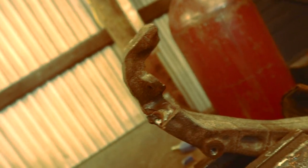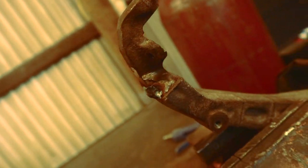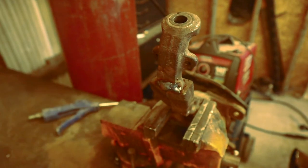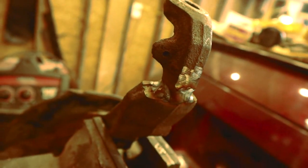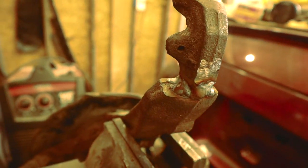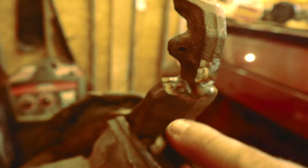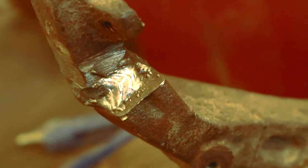What you want to do is go as high as your welder can possibly go, with low wire speed, and just really melt the metal together. Then I'm going to brush it all off and bring it up to give it more structural integrity. I want it to look like it blends in — here's a better look at what the first layer looks like.